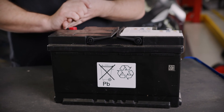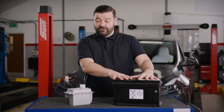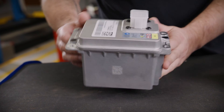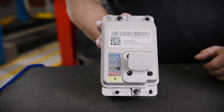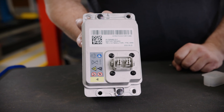Much, much more considering the Tesla's 6.9 amp hours. This here is the Tesla Model Y and Model 3 battery — a lithium-ion battery with a much smaller capacity. This one is 16 volts, consisting of four lithium-ion cells. At 6.9 amp hours, it's very different from a normal battery, which is anywhere between 50 and 120 amp hours. We have the main two connection pins and through the middle, three communication pins.